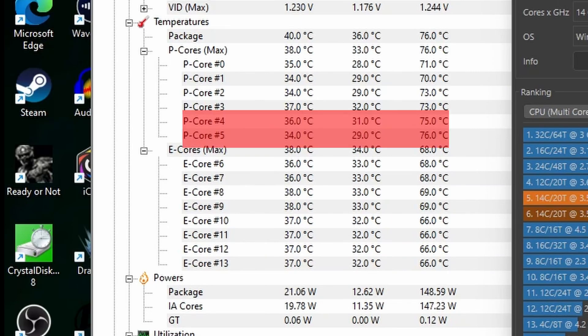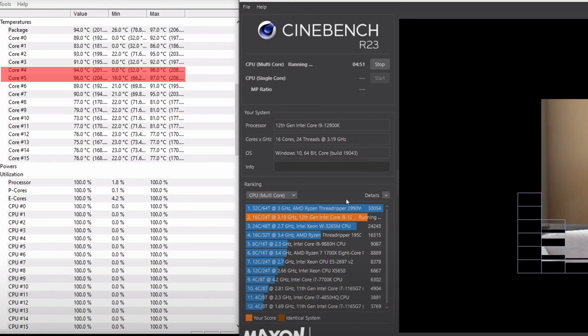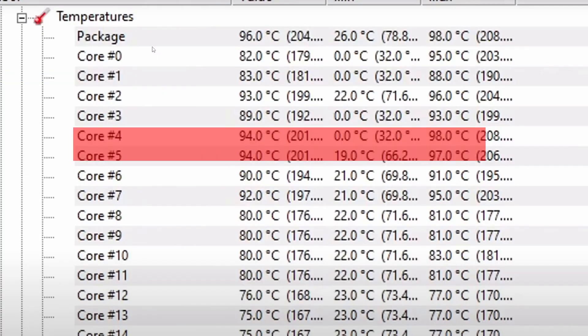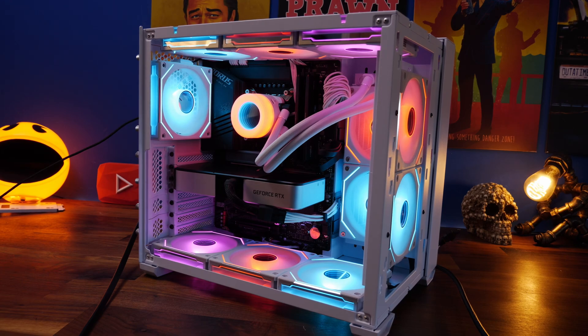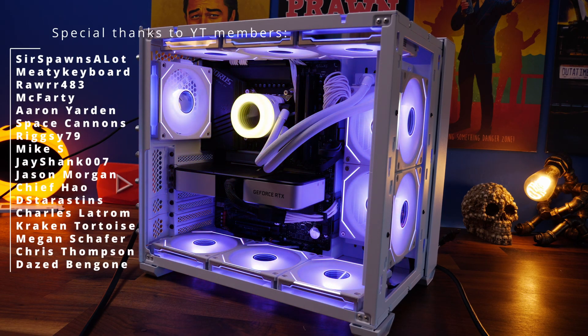This is not massively hotter — I wouldn't necessarily worry too much about this — but if you had a big discrepancy, say most P-Cores are 70 degrees but a couple are 90, that could imply one area of the CPU hasn't properly been covered with thermal paste and therefore isn't dissipating heat as it should. If one part of your CPU is running hot, the entirety is seen as running hot by the software, and Windows may throttle your performance to protect the CPU. Especially if you're reaching 90–100 degrees, you get thermally throttled, and that's a big problem — but one that can easily be fixed.